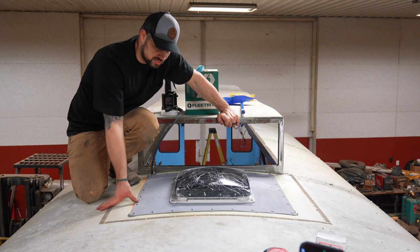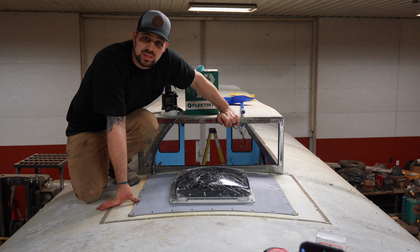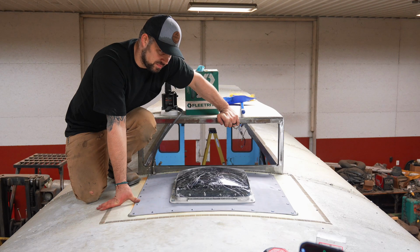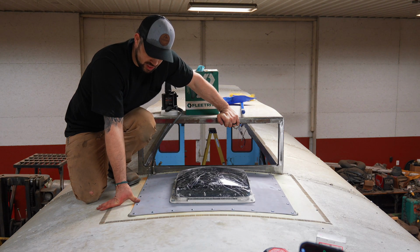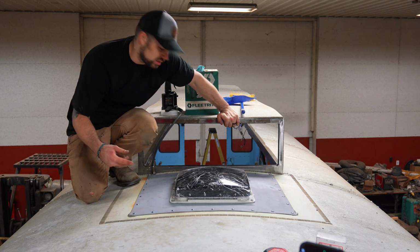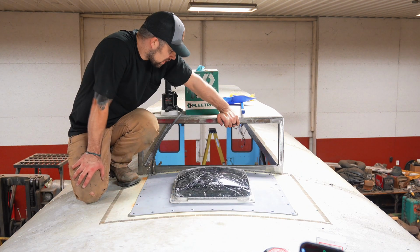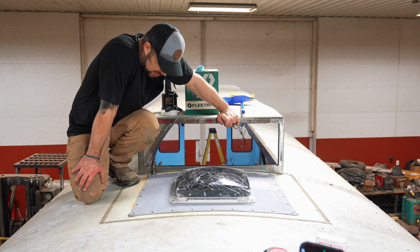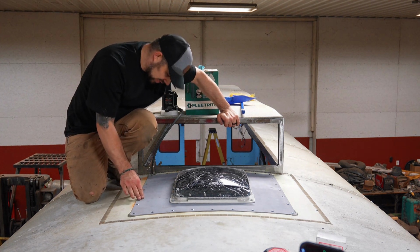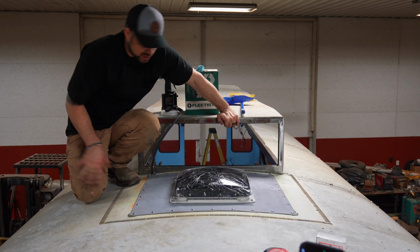The air compressor was a pain in the ass, but the riveter worked good. The compressor just needs to put out as much pressure as it can to make the riveter run efficiently. I was able to do like 2 or 3 rivets before the compressor had to kick back on and fill completely up to run the riveter again. But that took quite a while. But I'm pretty happy with the way it's turned out. It seems like it's pretty nice and sealed and strong. I guess time will tell.